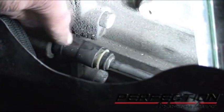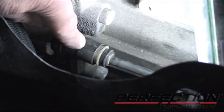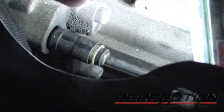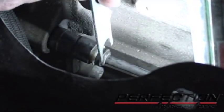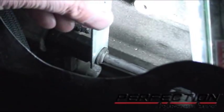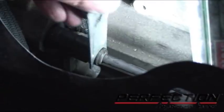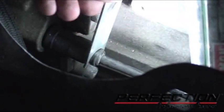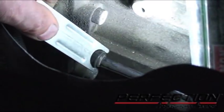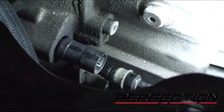This is the connection for the slave cylinder. This is the sliding ring that I have to push in to disconnect the tabs. This is the pressure line coming off the master. I'm going to put the tool in between the sliding sleeve and that coupling flange, push it in, and there it is — it's disconnected.